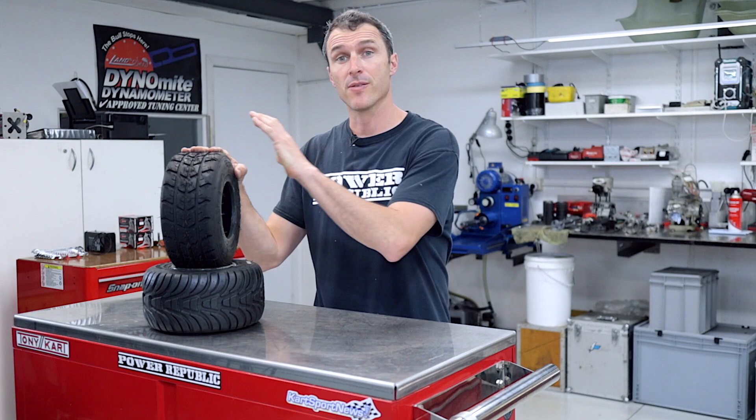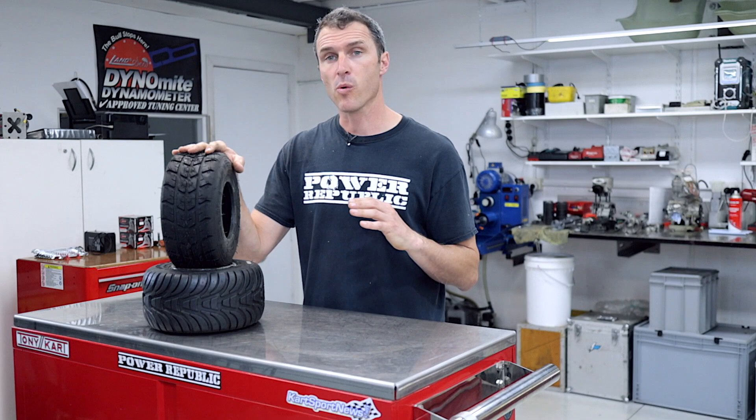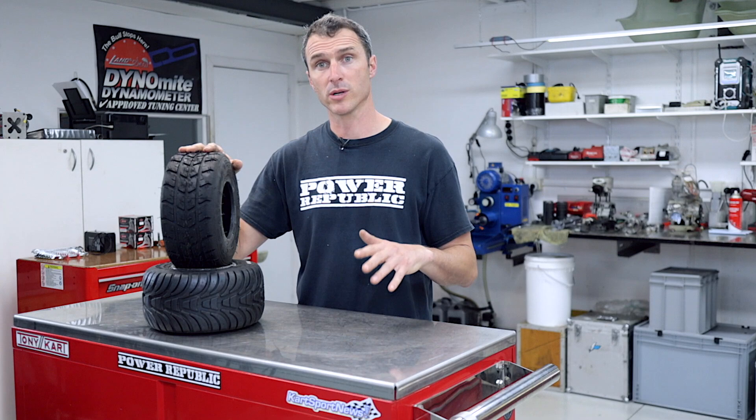One of the really hard things to work out is when to change to your wet tires. Being a very soft compound rubber, they get chewed out really quickly in the wet and especially in the dry — you can rip this tire to pieces in about five to ten laps if the track gets dry. Generally speaking that won't happen in the middle of winter or late into the evening or early mornings. If the track is wet in the morning it's going to stay wet because the angle of the sun is quite low, and especially in winter with lower solar radiation the track just stays wet all day and can be very greasy and cold. That's when you can use your wet weather tires even when the track is not so wet.